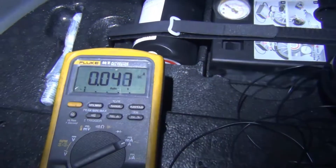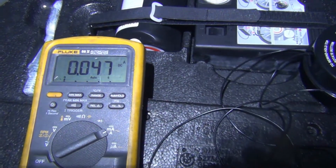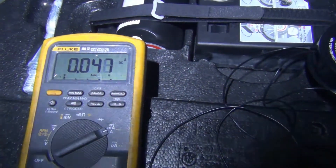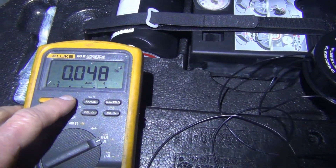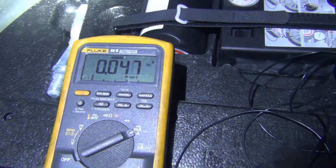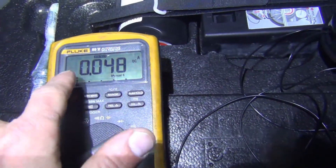That is what you want to see — you want to see 50 to 80 milliamps; 80 is a little on the high end. I don't like to see 100 milliamps — I've seen 100 milliamps and it'll drain your battery within a week; your battery might be at 50 percent if it was 100 to start with. So if you have your meter here now, you can set it to min-max and you can monitor for wake-ups. If you have a drain, you would actually see something like 0.100 or 1.2, which I can demonstrate in a second.